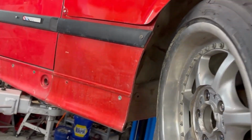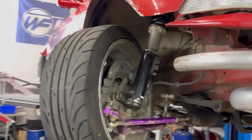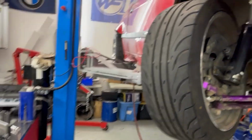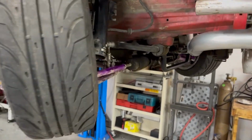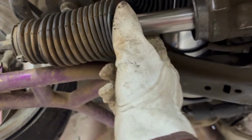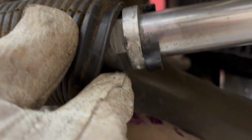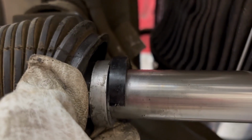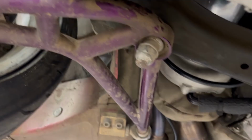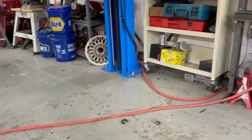For being an SLR Ultra kit, that's not all that much. I mean, it's a lot, don't get me wrong. It is an angle kit amount, but a cut knuckle will get you there. So I knew that I had overdone the spacer at some point trying to mitigate that steering shake. And it looks like I've got my aluminum one that I machined, that I always leave there. And then I forgot I added that much more for some reason when I was fighting. I'd rather it shake a little and have some lock.